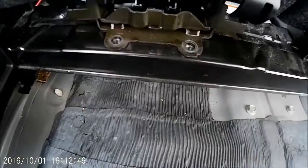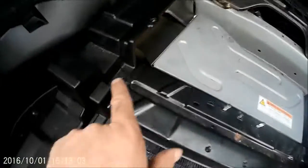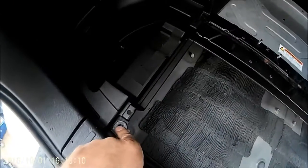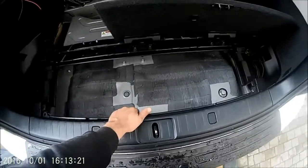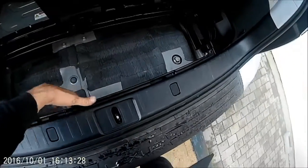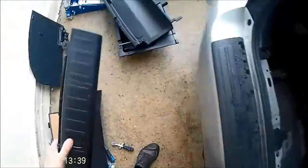Once that's out, you've got two 12mm bolts there - that's the hole inside - and this whole flat panel can come out. Once that's out, you've got another popper here, one here, and one on the right side. Then this plastic tray literally just pops up - push your little buttons in so you don't rip them off - and then it just pulls out nice and simple.